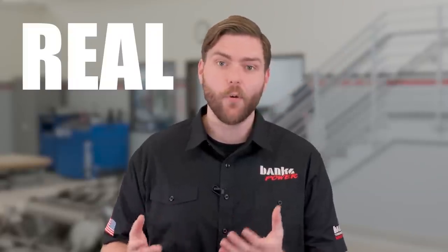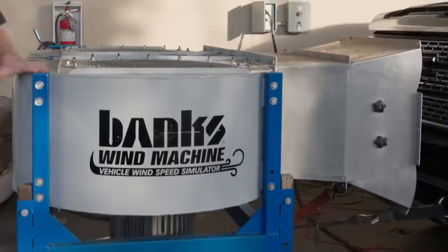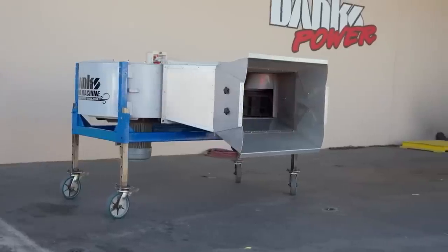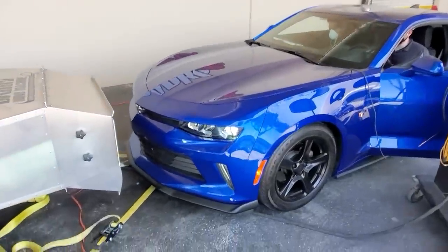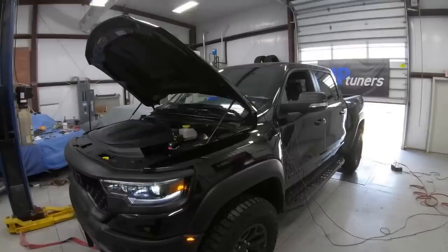The goal is to replicate real-world conditions. To trick the vehicle into thinking it's actually on the road, the cooling systems need to get the air they would see on the road — high volume, high velocity airflow. In a previous video, Gail walks you through the use of our Banks wind machine, which replicates highway speeds on a truck or vehicle. It has adjustable legs and an adjustable snout for the flow, so we can go from a lowered car all the way up to a lifted truck. This fan setup flows over 40,000 CFM of air at up to 60 miles an hour. If you see a dyno operator with tiny carpet fans and the hood open to keep the temps down, they aren't replicating road conditions.